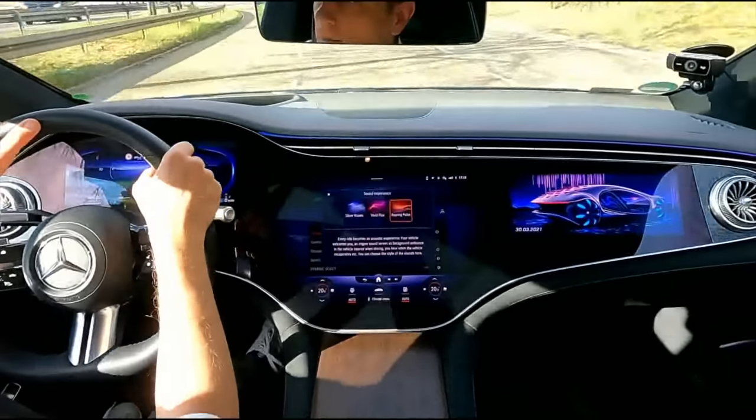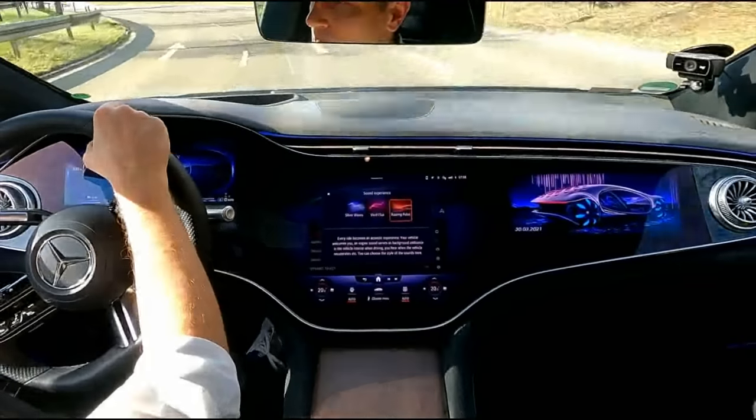In terms of AC charging, it's 40 amp or 9.6 kilowatts — this could be for the European versions, and we'll see what the US cars come with. On a battery this big, 9.6 kilowatts is about 12 hours for a full charge from zero. I think it really needs closer to 80 amp onboard charging. The vehicle is also plug-in charge capable, so at Electrify America you'll get VIN recognition and automatic billing. Mercedes has a service called Mercedes Me Charge that comes included for two years.